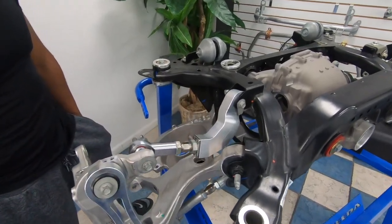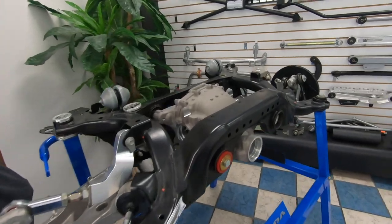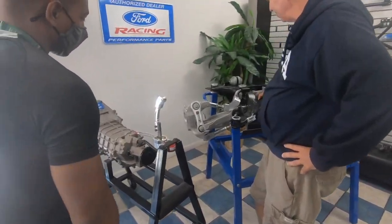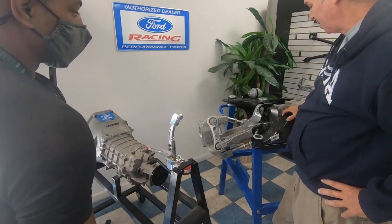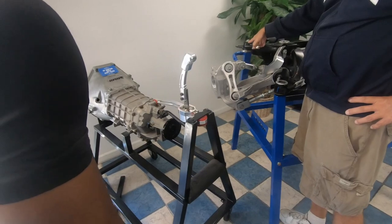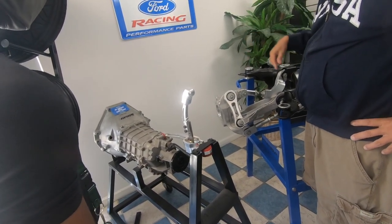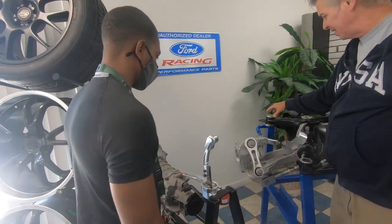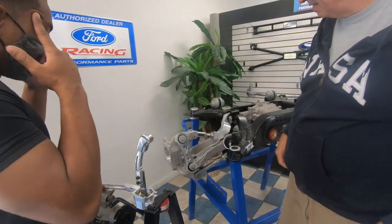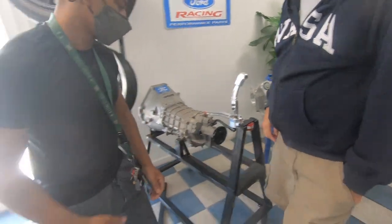All right guys, pulling up to Steeda. I love how they got all these parts on display here - pretty cool spot. So we talked to the guys - they mentioned the vertical links with polyurethane. We've run into issues where these inserts have serrated teeth that are always in the same position vertically, so when you put these on sometimes the teeth don't grab the body. But that doesn't make a noise like that when it happens. It has to be the vertical link but they're not sure - they've only heard that happen in seven years on maybe three cars.